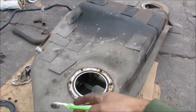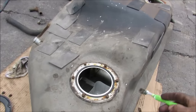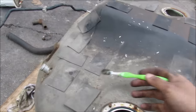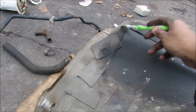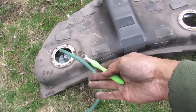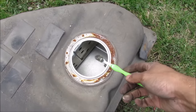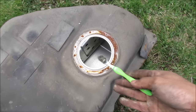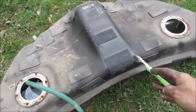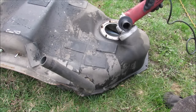Here we have the bare fuel tank — it's basically just a stamped steel clamshell that's welded all the way around its perimeter. To get a really close look inside we're going to need to cut this open to see how all the baffles work, as well as the valving behind all of these hose ports. I'm going to play it safe by filling up this tank with water so it doesn't explode from the gasoline vapors when I cut it open. Interestingly, the other side fills up first before this side, because the fuel level has to level off and go over the bump before transferring. I'm just going to make an incision with my angle grinder along this area here.